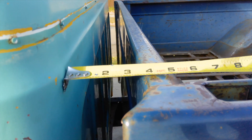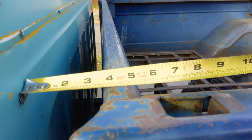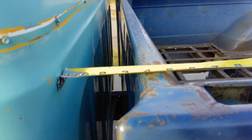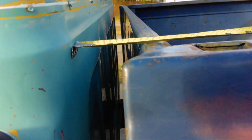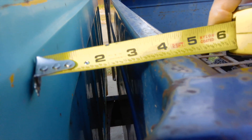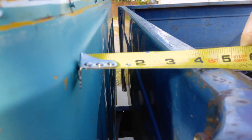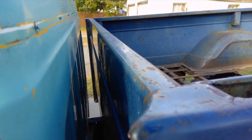Right now I currently have a space of about three and a half inches from the back of the cab to the front edge of the box. I'm okay with having that kind of gap on this truck — it's fairly big. But if you wanted to get this down to factory specification you'd probably want to shorten it about an inch and a half, maybe even two inches, which we would take off the wheelbase.